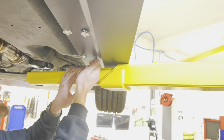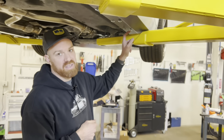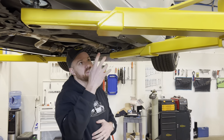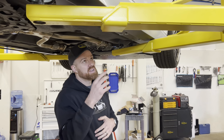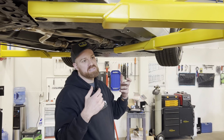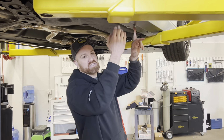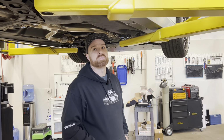One thing to note as you go through to tighten these, the ones that are the number 14 and the number 12 screws, you don't need to get carried away with really cranking them down. You just want to make them snug, because again, they're in those plastic inserts. And so you have all the machine screws that are in metal, which you can get nice and tight. But if you just keep cranking on these, you'll actually start to crush the plastic and potentially rip those inserts out. So that's just something to be aware of.